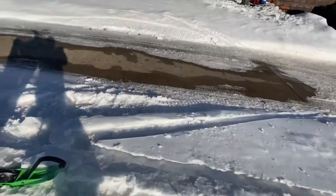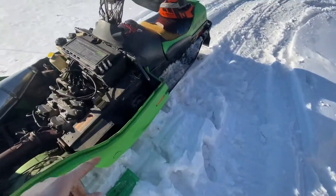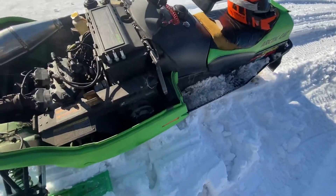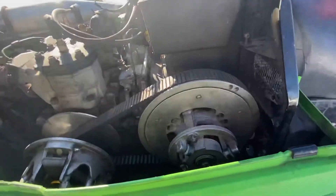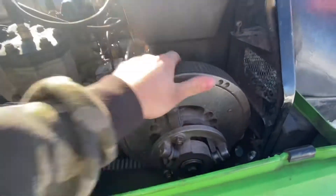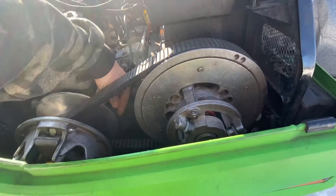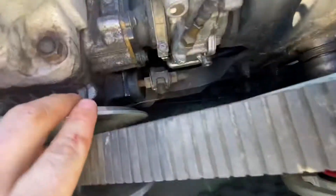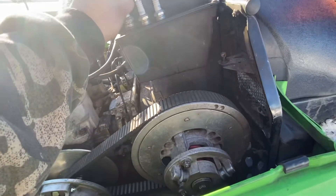The secondary clutch bushing is shot, so it'll go back and forth a little bit. All that extra romping on it plus wear — the belt that was on it was very old and really bad. But it had a brand new spare, which I put on. You can kind of see the bushing's bad on this one, but this other one's fine. There's a little bit of old belt right there.